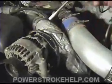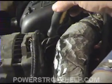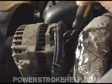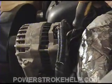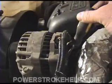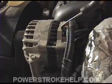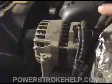Now, the shade tree way is you use a screwdriver and you stick it to the back. And if there's a magnetic field created at the back center of the alternator, then your alternator is more than likely functioning correctly. This is an old-school way of doing this — real shade tree stuff. But sometimes that's all you got when you're in a pinch. This will tell you fairly quickly if your alternator is working correctly or not.